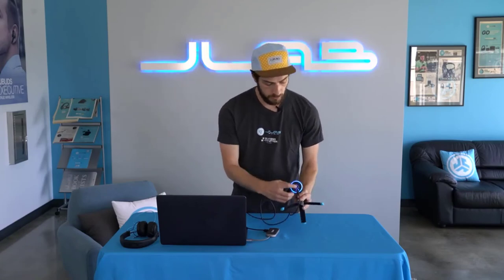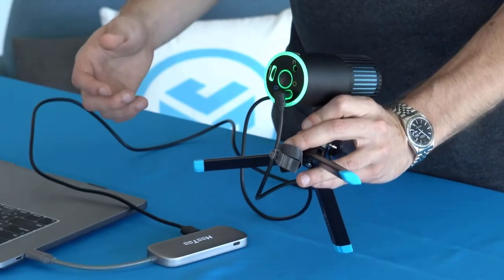Cardioid is great for things like voiceover, where you just want the mic to pick up your voice. The other directional pattern available with the TACO is omnidirectional, which is great for group settings where you want to hear everybody — things like a conference call where you're all gathered around. That mode picks up sound in every direction. To change from cardioid to omnidirectional, hold down the button on the bottom and it will change to green, indicating you're in the omni setting.